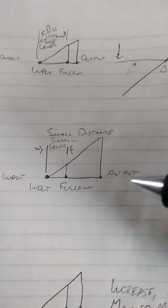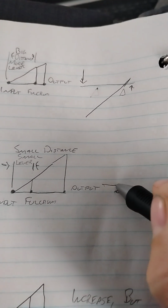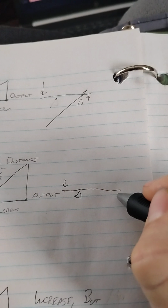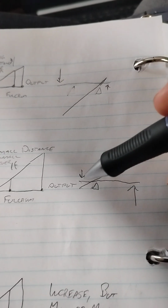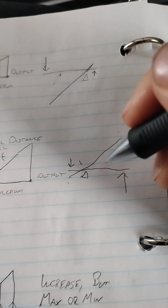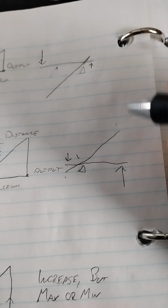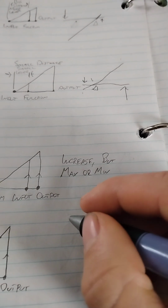So your second reverse gear example, the fulcrum was really close to the input. So let's move our input here. Now we push down, and the output moves a lot further, right? Like that. But remember, torque is a function of force over distance. There's a big distance here and a little distance here. So this force is going to be harder to lift from this side, but it will move further for the amount that this moves.